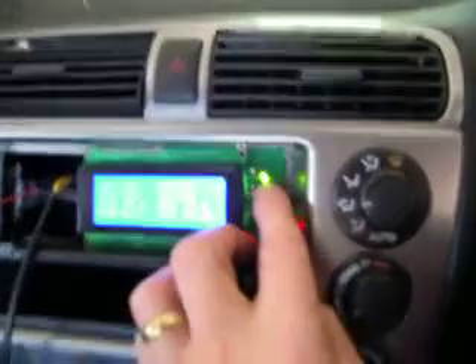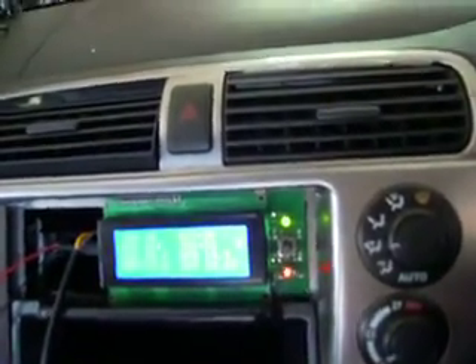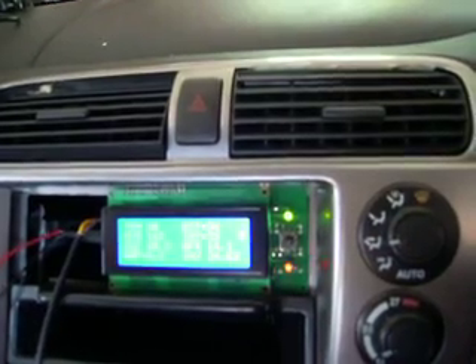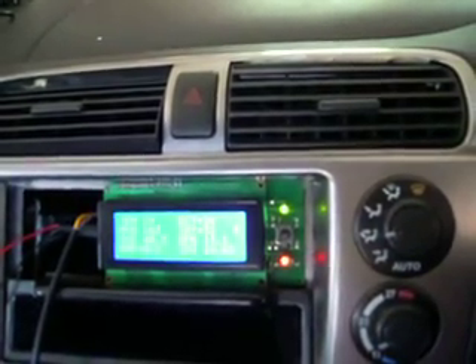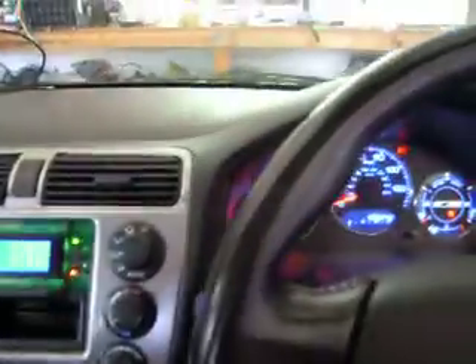The engine's ticking over, so I'll engage some regen. Now regen's come online — it's regen at 18 amps. The engine's struggling and the engine has stalled. So that regen level was a bit too heavy there.